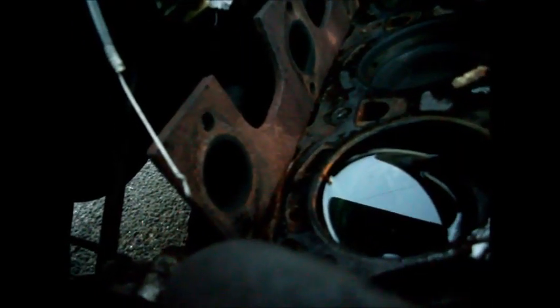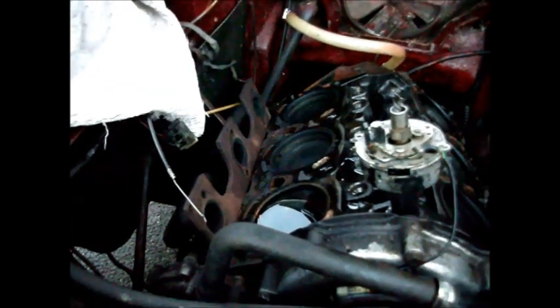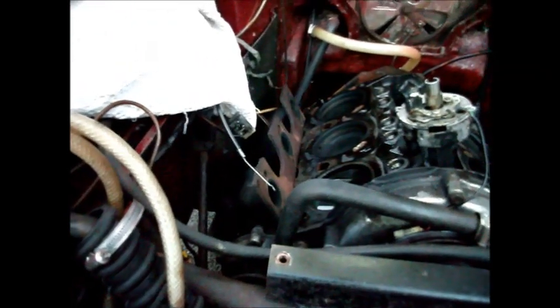But also the real clincher is the rust. As you can see here, we've actually got some rust adjacent to that waterway, and I don't know if you can just see, there's actually a trickle under the water on the side of the bore. So obviously that's been venting in. I think that's where the gasket has blown, and actually I can see the line of rust is under the gasket itself, so it's adjacent to the block, not adjacent to the head. So I think that's the culprit. Next thing is obviously fixing it, which is another matter entirely.